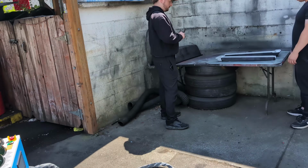Now we can actually see there's some cracks here where the valve cover is bolted down. Maybe even if we sandblasted, it might have more of a dull finish, and you might not see that crack. With sandblasting, the garnet would fill those, and it can almost shot peen the surface, and you wouldn't notice those cracks. Yeah, so that's really important. This level of cleaning allows for expert inspection, which I really do enjoy as well.